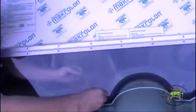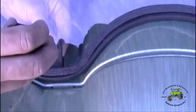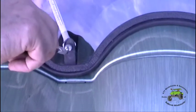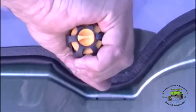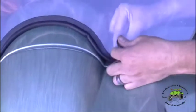Now that we've got those done, we're going to take our center support brackets and set them in. We're just going to drop those in. Once you get to this point, your windshield is set and it's not going to move. So you don't need to do one side then the other — you can go ahead and get this one cinched down nice and tight. Tighten it by hand in the front, then cinch it up in the back nice and tight. That just locks it up. Aluminum hinge so you don't have any problems with rusting. The reason you want them loose is so you can wiggle to where you need them to fit.